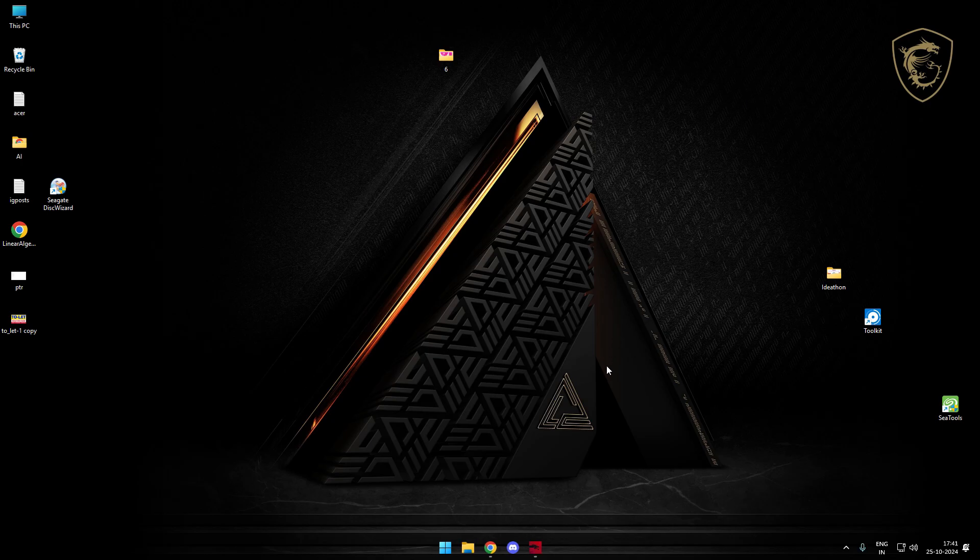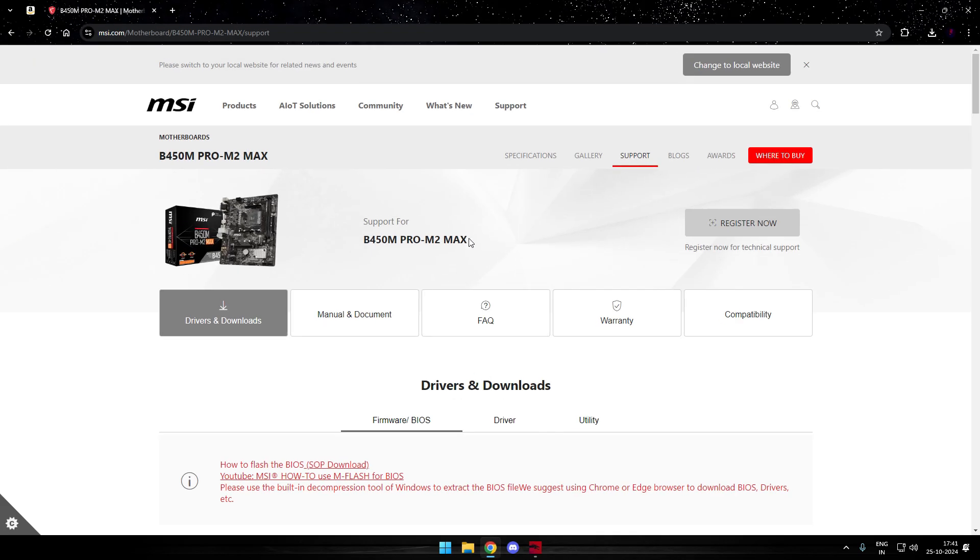That's all for this video. If you are updating your BIOS for the first time, just remember two key points. Number one: you have to download the accurately correct BIOS version for your motherboard. Otherwise, if you download it for the wrong model and flash it, your motherboard will be instantly and permanently dead — unrecoverable. Number two: when you update your BIOS, make sure you have a power backup, because in case there is a power loss during the BIOS update, your motherboard will again become unrecoverable. If you are facing any issues or have any queries, comment down and I'll reply. If you are new to the channel, don't forget to subscribe as we keep coming up with such videos every week. Thanks for watching.